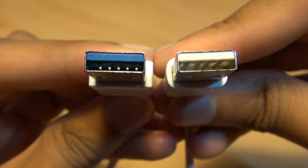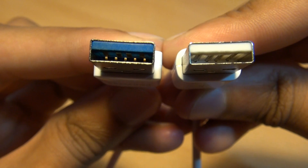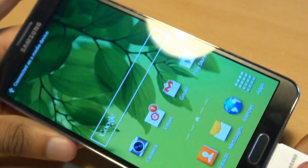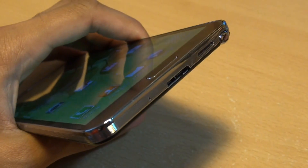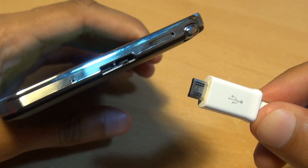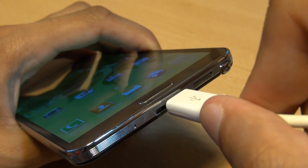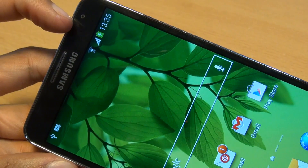However, the Note 3's USB 3 connectivity is symbolized with a blue interior along the left-hand side, and the USB 2 connectivity for the S4 is symbolized with a white interior along the right-hand side. I wouldn't worry if all you have access to is standard USB 2.0 ports, whether on chargers or on computers, because USB 3.0 is backwards compatible. You can still use your micro USB 2.0 cable, like from the Galaxy S4, or any other micro USB 2.0 connector — plug it straight in towards the right-hand side of the micro USB 3.0 port and it will still recognize it as a media device and charge it as well.